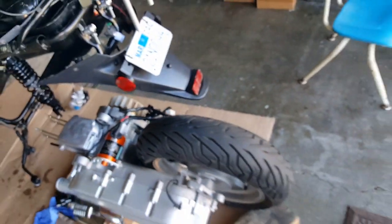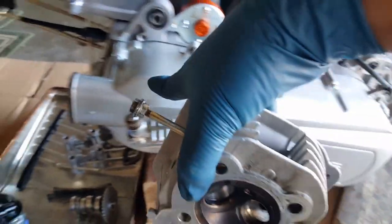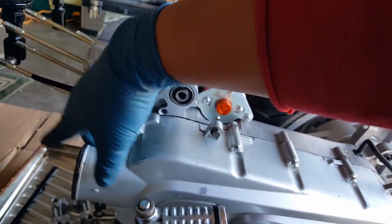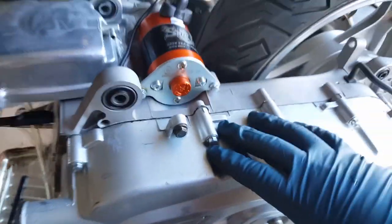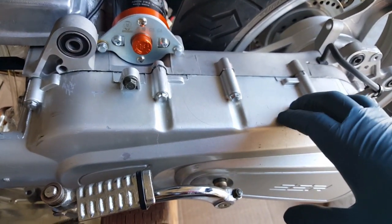We're going to try putting the whole thing in there to get it a little bit cleaner. Today's objective — I can't do anything heavy since I can't move my back too much. I'll probably take the CVT cover off. We're no longer going to use the kickstarter — we're going to take that complete assembly off and install an ankle biter with allen bolts. Most of the time the ankle biter comes with allen bolts and it's a nicer design. I can still protect the CVT a little bit from that side.